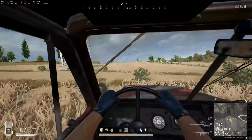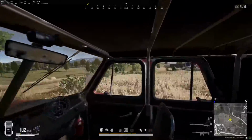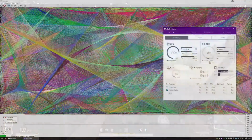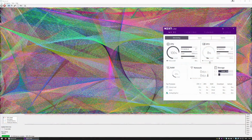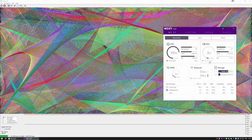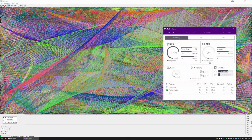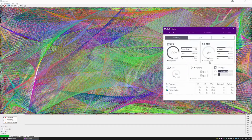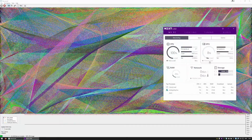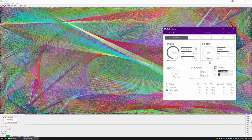I've used water cooling on a graphic card, and it went from 45 to 55, so 63 is quite alright using only air. With the S24 at full load, it was going 65 with PWM control on the AIO, and 73 in automatic mode with dual fan control mode. I was playing for more than a week with the VECTOR RS and different configurations with the S24 and S36. They basically had almost the same temperature, except the S36 was a bit lower than the S24.